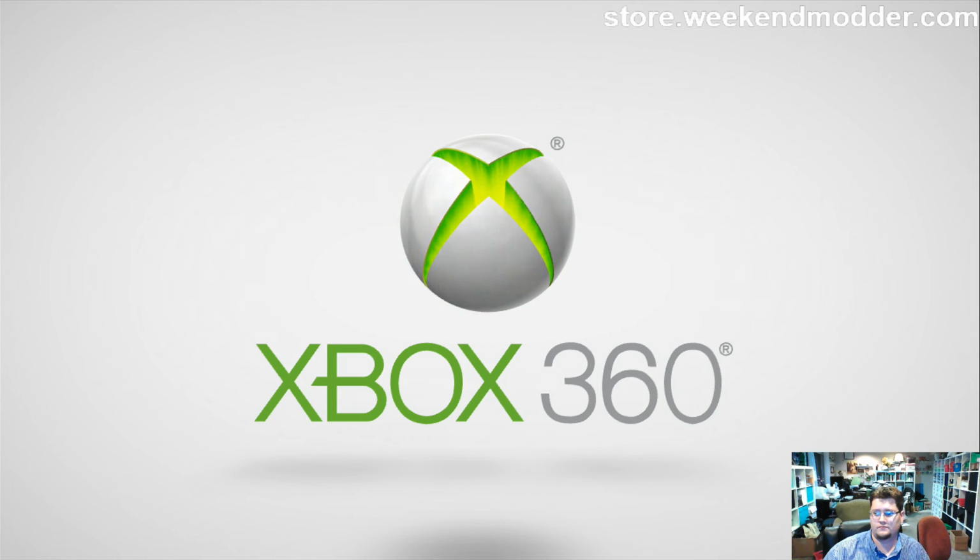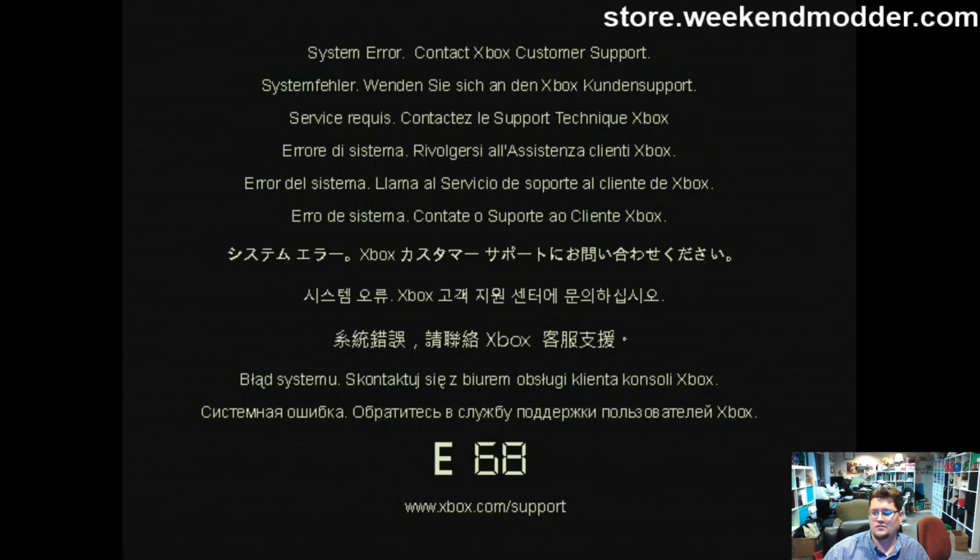So, do we get Freestyle or do we get E68? It's hanging up here for a long time. I'm going to bet E68. Yeah, there's kind of a weird sound coming out of that hard drive too. And there it is, E68.